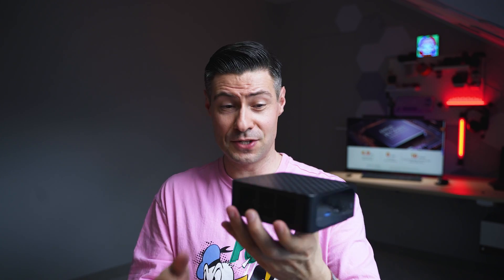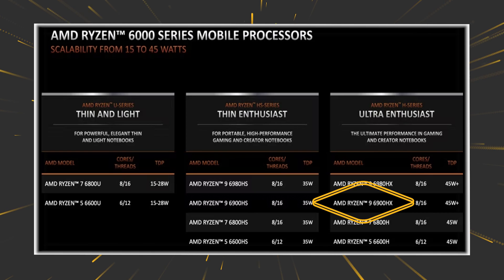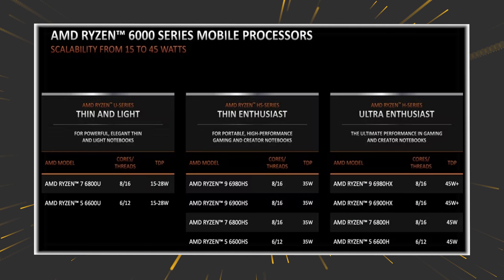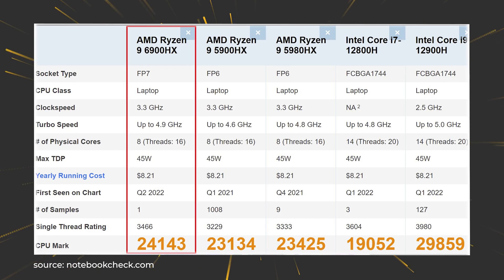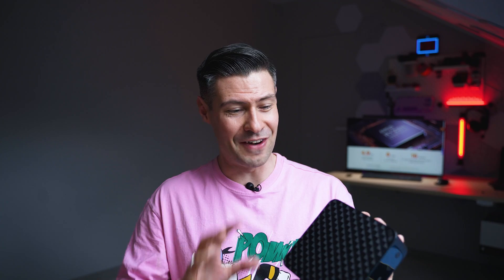Being a new 2024 model, this comes with a Ryzen 9 processor with a few catches. The hardware is laptop grade — we have the 6900HX, something that got released in early 2022, so it's a bit older. But Beelink are offering it at an amazingly good price and in terms of performance it's not that far from 2024's Ryzen 9 mobile processors. In terms of hardware it has a really good pack: dual-channel DDR5, two M.2 drive slots and a lot of other goodies to explore alongside real-life performance.